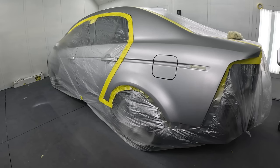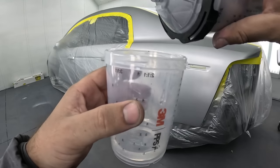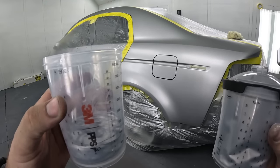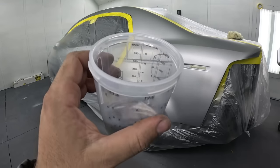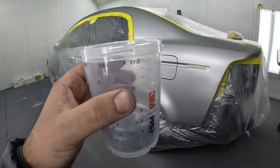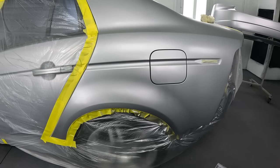If that doesn't look good and you're having an 'oh crap' moment, take that blending additive and mix about one ounce to one ounce with your paint. This takes away the strength of the metallics and helps even more. Then take this coat and put it even further out, but not too close to the door. Run one more coat of this 10 minutes after your last full-strength base coat. Go just a couple inches past your last blend and it will smooth it out, eliminating any stripes or halos around the blend.